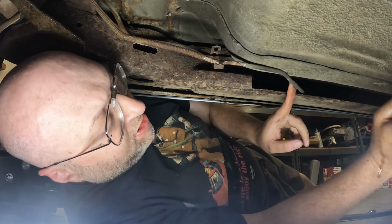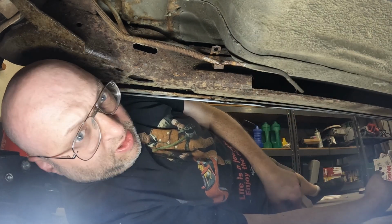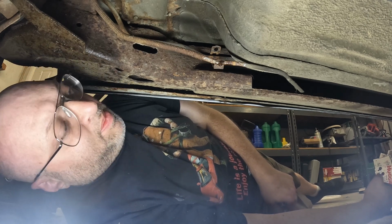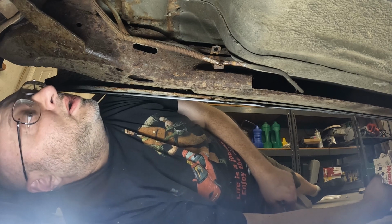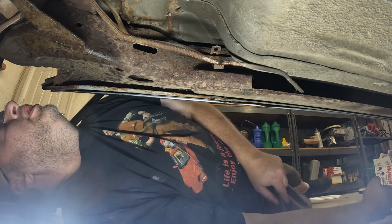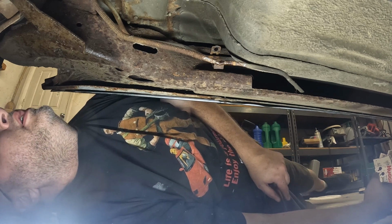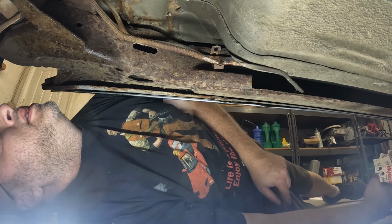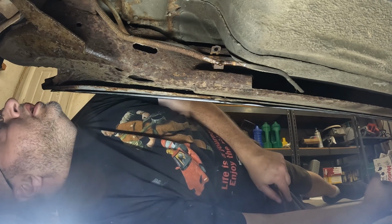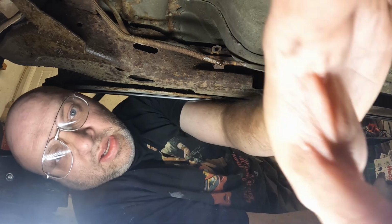The other option I got is if we cut it right there with a saw, put these compressions on it, we can run it all the way back. A new piece and throw this away because this one has had it. And I got another fuel line clip back here, I see. But that's not really that big a deal. So, alright, I'll be right back with you.